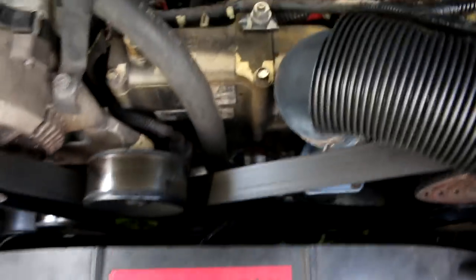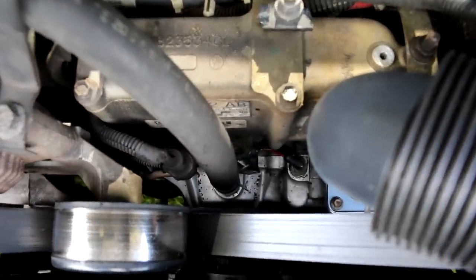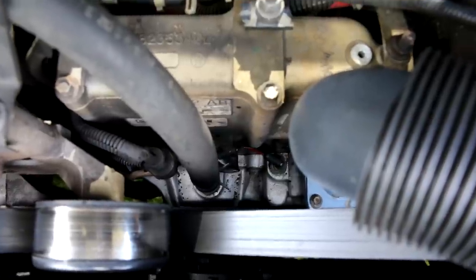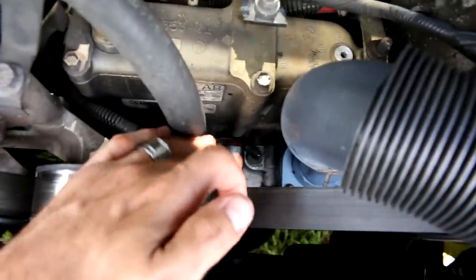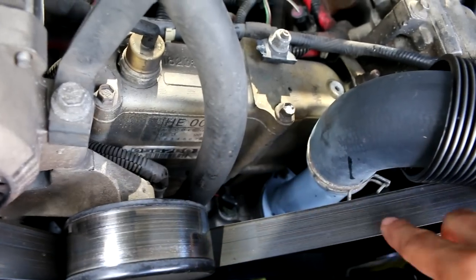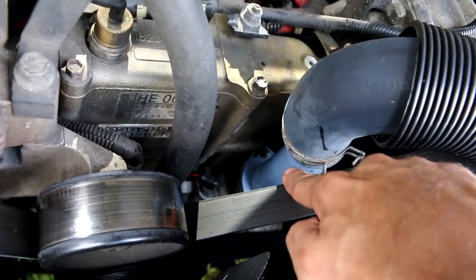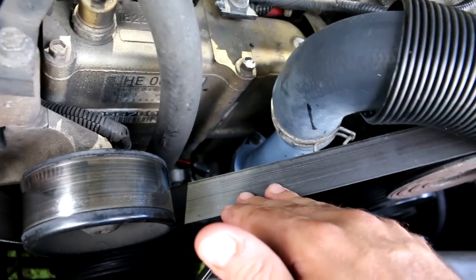If you look back there you can see the water pump is also new — I replaced that at around 170,000 miles, so about 30,000 to 35,000 miles ago. Along with that I replaced the serpentine belt when I lost the AC compressor. When you change the water pump, also change out your thermostat, which sits underneath this little tube right here. I highly recommend just buying a new tube because you'll never get the old thermostat housing tube to seal back properly. Just trash it and replace it — it costs like 10 or 15 bucks and it's well worth it.